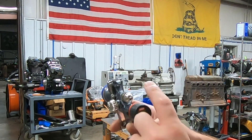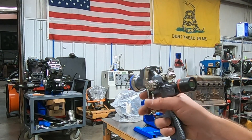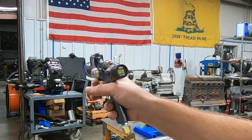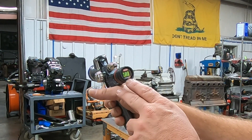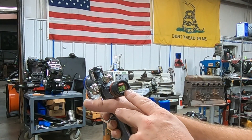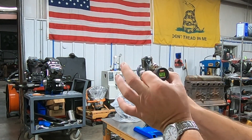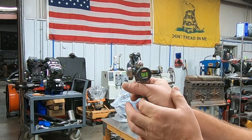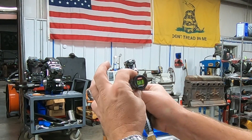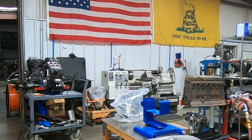You can see the Atom dock installed here — when you supply air to the gun it automatically turns the gauge on. Right now we're at about 44 PSI at the gun with the compressor fully charged. When we pull the trigger completely, we drop down to around 26 to 27 PSI while actually spraying. To adjust it, you pull on this dial and can turn it fully open — I can see I'm at 29 PSI fully open, so I'll dial it back down until I get an average of about 28 PSI.